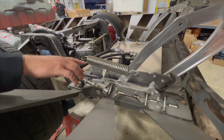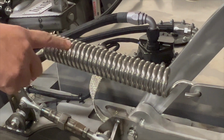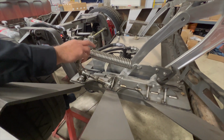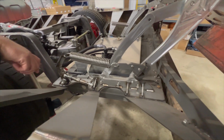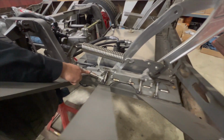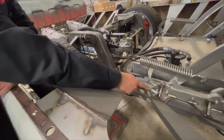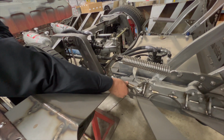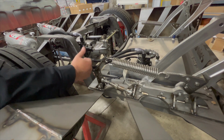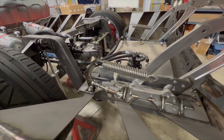So this whole system works together. These are actually stock '66 Chevy hood hinges and hood hinge springs, which I kind of wanted to throw in there just for the fun of it. Are they stainless, or just polished? Stainless, and they're reproduction pieces. But this turnbuckle has a pivot down here and a turnbuckle here, and you can adjust it to tension and reduce the preload on the spring. So you can put the spring on easily, then open it up and preload it so that we get the balance on the bed just right.